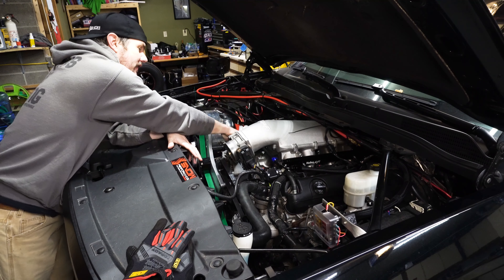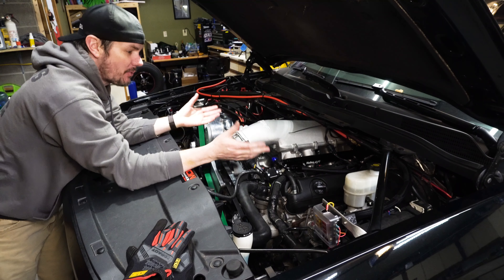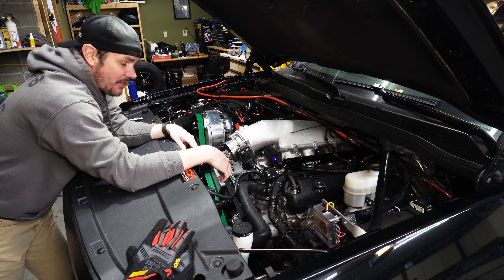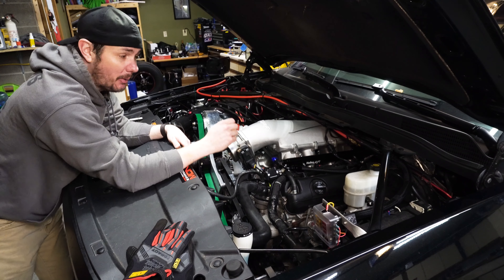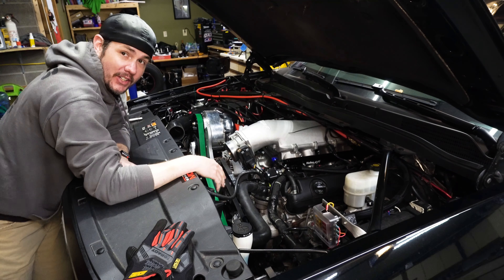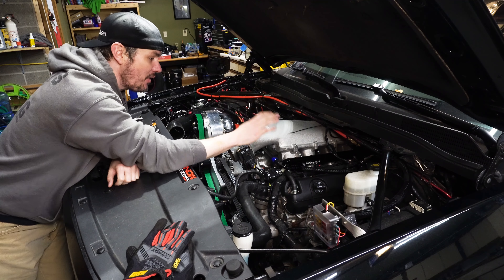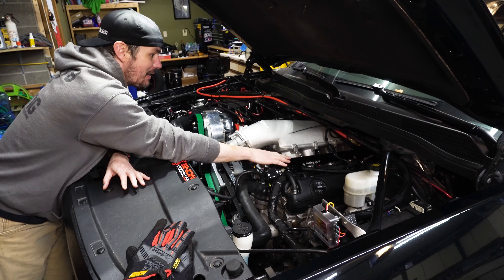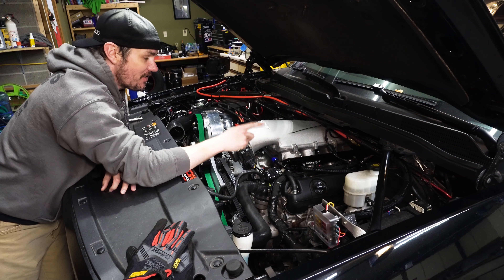What are we lacking? Well, we've got a fuel pressure sensor over here. We're running a returnless system with a PWM control on the pump. In fact, I've got a 525 liters per hour pump on the way that will allow us to continue PWM control. Where are we going to have issues? Well, I think down the road, not necessarily initially, we might have issues with maintaining pressure on these fuel rails because of the size of the line.